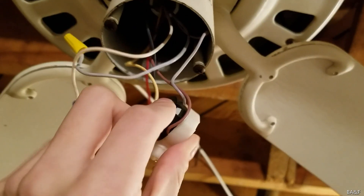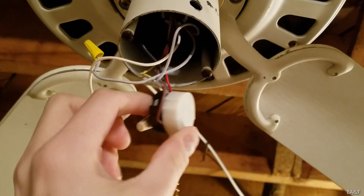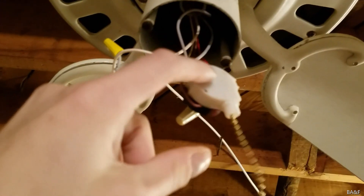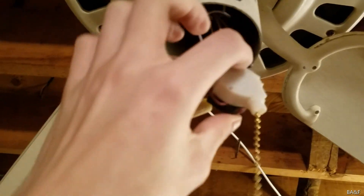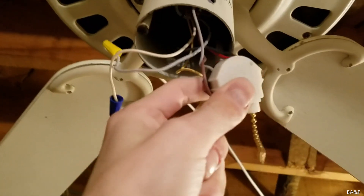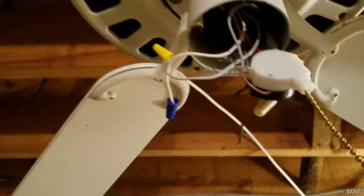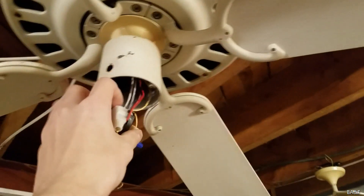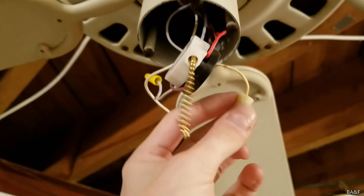This is a cast aluminum motor, and there's one wire for common and then four speed wires. There's technically a high, medium, and two low speeds. What they did was wire the two low speeds together and attach them to one terminal on a three-speed pull chain — which I thought wasn't good because it could damage the windings.